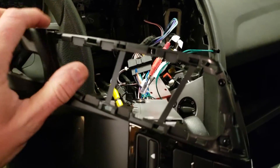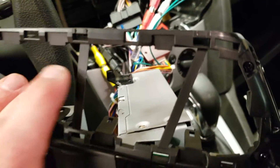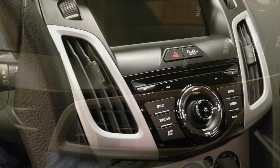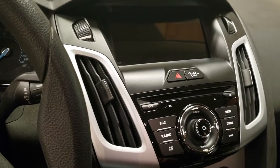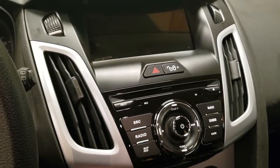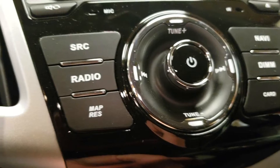While installing the unit to put the vents in, you do have to cut these little plastic tabs out. You can see on the factory one there isn't anything there — the vents won't fit in if those tabs are on there. Just take a pair of wire cutters and trim out these little pieces of plastic first so your vent can fit in. The hardest part of this whole install without a doubt is getting that wire connected for the switch here — it took me about 10 minutes. I had to loosen the harness a little bit to get the wire to come out further. The last piece is just putting this little trim piece back in under here.